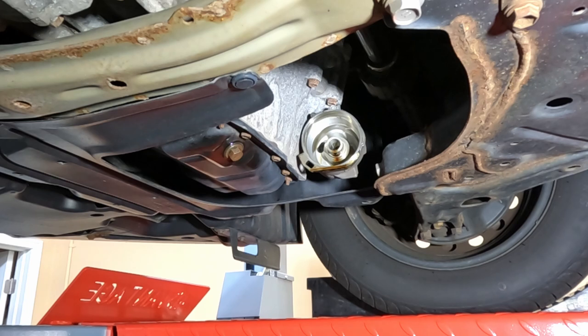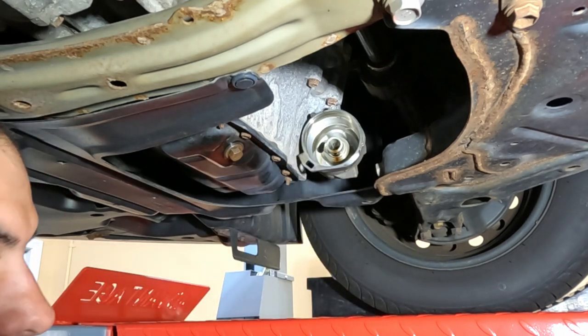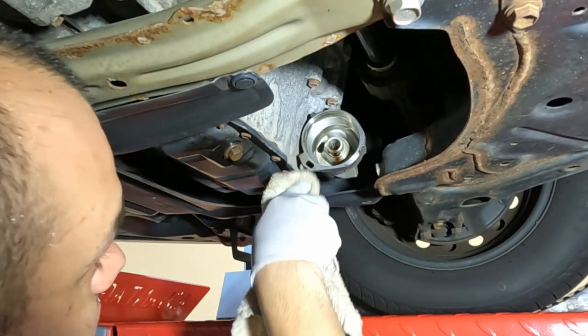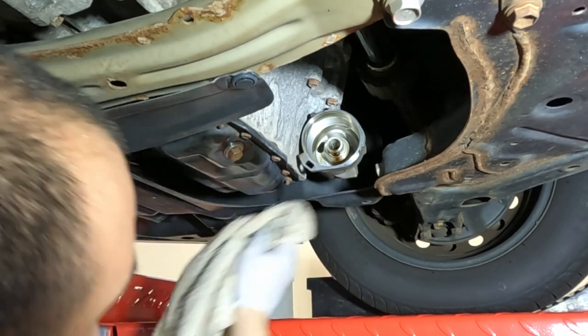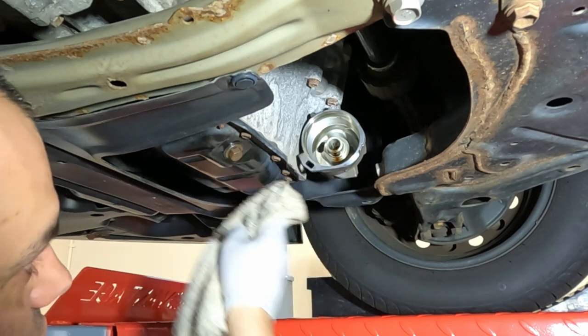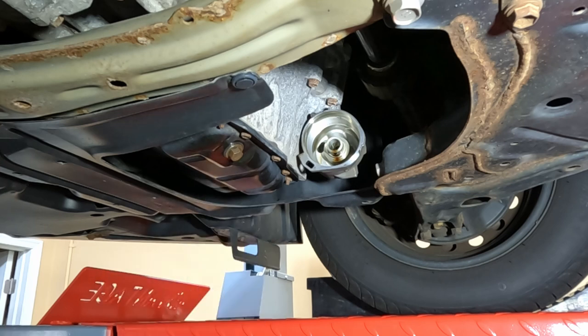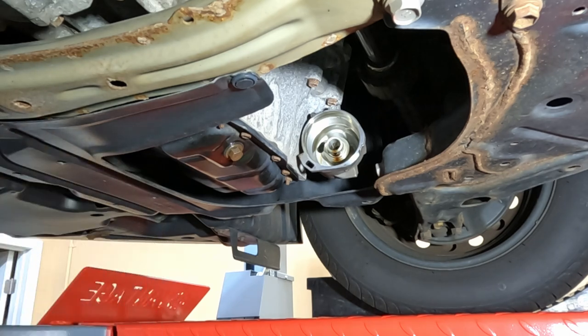And then I'll lower this down for the oil filter housing to 18 foot-pounds. Before I button that up, this is basically done dripping at this point. I'll get my upright oil drain out of the way. Everything here looks very good, nice and clean. We want to wipe off as much oil as we can so we don't accidentally think we have a leak when we don't — it's just residual dripping from the oil change. Also, get a box of disposable gloves. You don't want to use mechanics gloves when you're doing an oil change, because once you get oil in a nice set of mechanics gloves, you're never going to get it out.